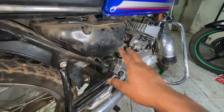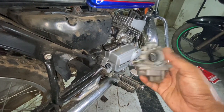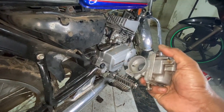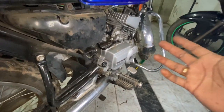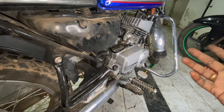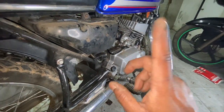If the air filter element goes bad, it crumples and gets plugged into the holes, and your bike won't start or it will start revving uncontrollably. The carburetor I'm holding is from a bike with an idle surge issue — the moment you start the bike it revs to 8000 RPM and you cannot turn it off. If that happens while riding you'll need to pull the clutch to bring the bike to a stop — it's quite dangerous. So regularly maintain and change the air filter element if you see it getting damaged.